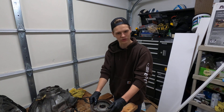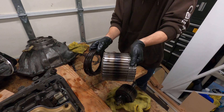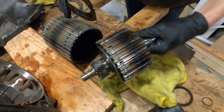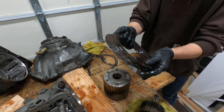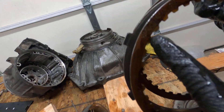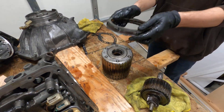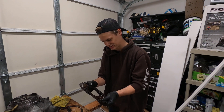What is this — number three? Third clutch? Something like that. Third, second. You can see all that burning right there, all that black, shiny and then black. And then look at this one on the inside — like even more cooked. And then these are the clutches, and look at that — it is gone. It's literally straight up down to the metal, and there's like chunks taken out of it. Super weird. Definitely need some new clutches, that's for sure.